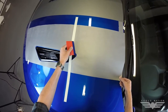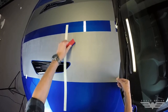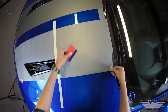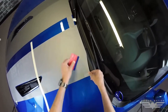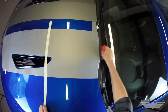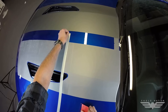We tacked up the side next to the void up top, then keep the material off of the car with your right hand and start working back and forth with even strokes, going back and forth until you reach up by the windshield. Always make sure you come back with firm squeegee strokes after you've done this to make sure there's no air left. Very firm — you almost want to feel the metal bend a little bit.